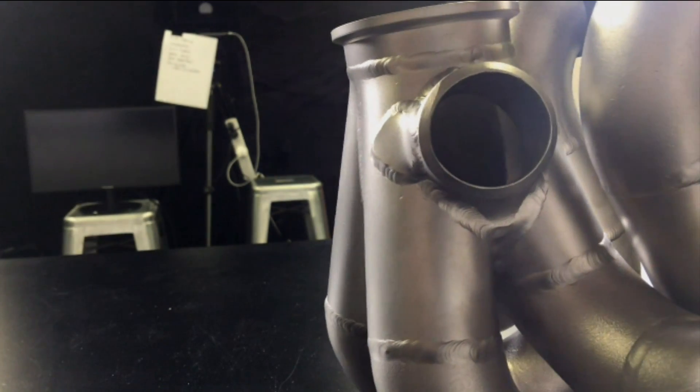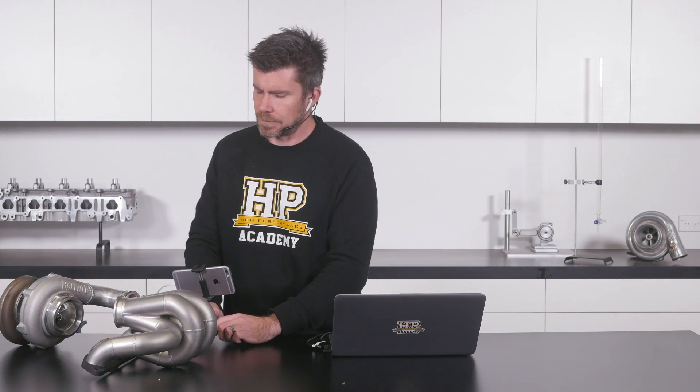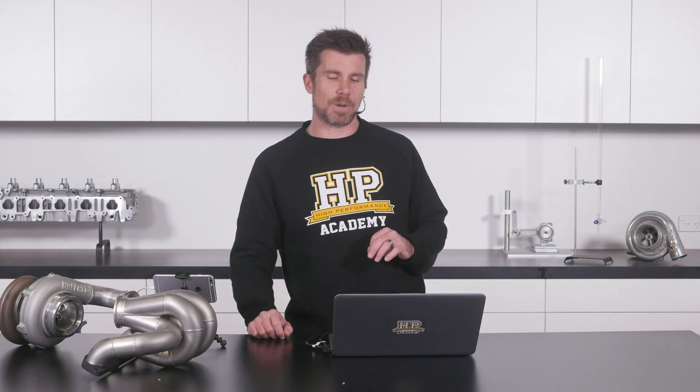There's still a little bit of work to do — we need to finish off the mounting for that wastegate and get it welded up. This is something I see done incorrectly so often, and it's really frustrating because there's nothing we can do electronically to lower the boost down — you get this exponential effect where as RPM climbs, boost just starts to skyrocket. That can be incredibly dangerous for your engine. Even if boost stays within your absolute maximum and you can tune around it, it gives a really horrible torque curve with no way of reducing engine torque at high RPM. It's really easy to fix at the design stage but much harder to fix once the turbo setup is complete.